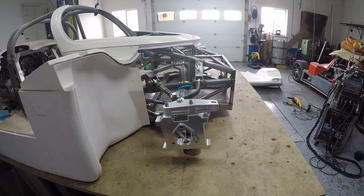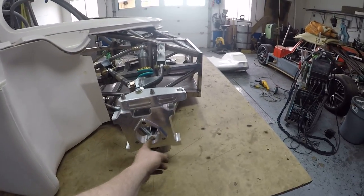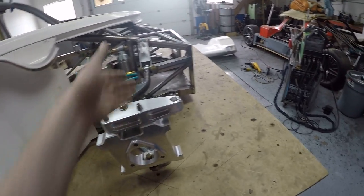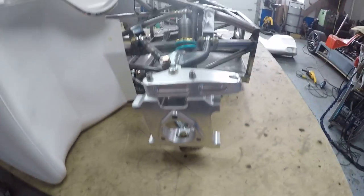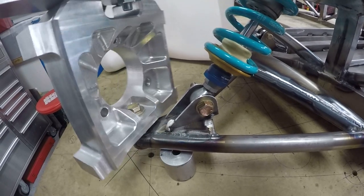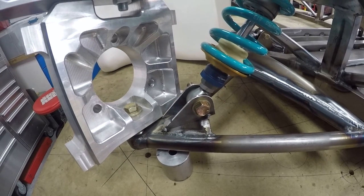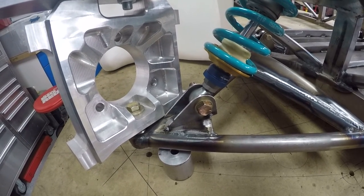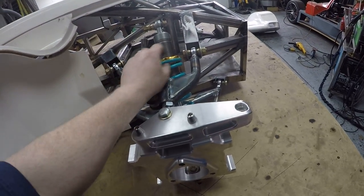The shock absorber is actually leaning back slightly - it has a little bit of a rearward tilt. The reasoning is that the lower wishbone with the caster is actually forward of the centerline, so the shock from the bottom has to be positioned slightly forward through the bearing. I've biased that shock mount as far rearward as I can while still having enough clearance for the steering. I've got 35 degrees of steering lock in both directions, and the car will probably need about 32 degrees, so that position works.